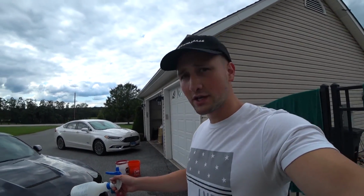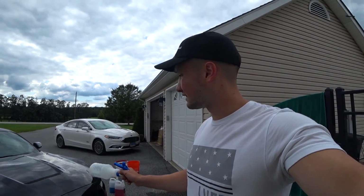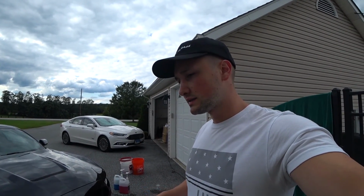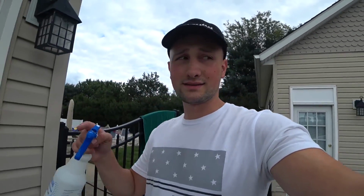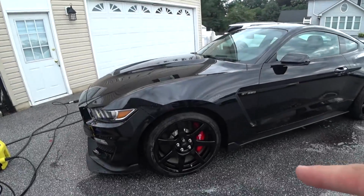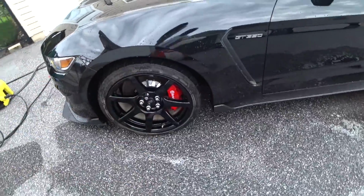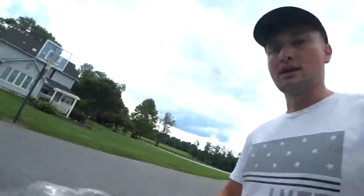So I'm actually going to change up my process. I'm going to do a full wash of this thing, then I'm going to clay bar it with a synthetic clay bar, and use my Iron X to get the iron off, and then my favorite product, which is P&S Bead Maker. I'll put a link in the video, but that product is bad to the bones. You can see how clean these rims are. I already cleaned them. See, I was talking about the white inner layer coat. My backs don't have it, but yeah, we'll get to it.